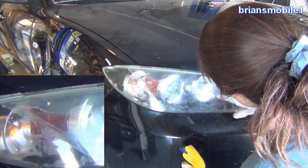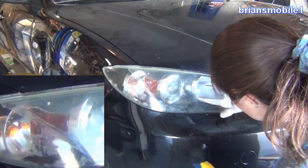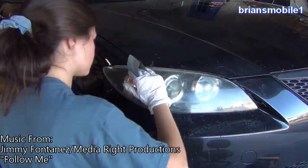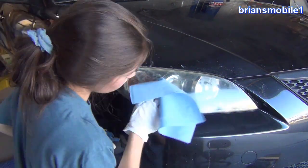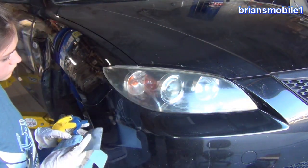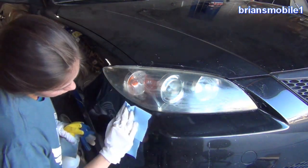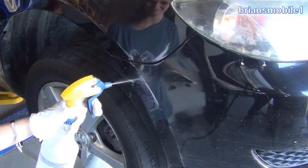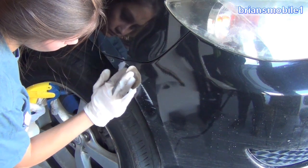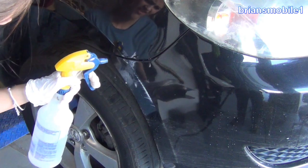The sun doesn't do it evenly because when the clear coat is put on, it's not put on evenly. People don't wax their car evenly, so we're just trying to get rid of that splotchy stuff. You can mask and tape this off or just be careful — either way you're kind of all right. If you get a little sanding on the surrounding area, you can just hit it with the buffer when you go back through. Is that coming off pretty easy? Kind of disappearing, huh?